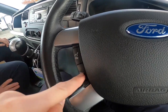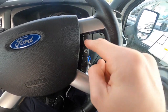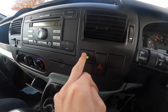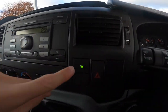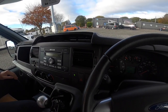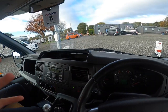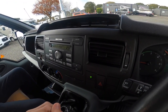You do have on and off for your cruise control, set it by plus and minus — speed up, slow down. Should you have to cancel it, that would be by the foot brake, and you can press resume to the last speed set before the engine was turned off. You've got your hazard lights. This little light here will light up to indicate that the diesel heater is on — you need to manually turn that off from the back and this light will go off. You can run with your diesel heater on in the winter, which will preheat the back of the motorhome, and it's totally legal. It'll heat the vehicle habitation side when you're driving so you're not having to warm the vehicle up from cold when you arrive on site. You may want to turn that on the last 10 minutes of your journey.